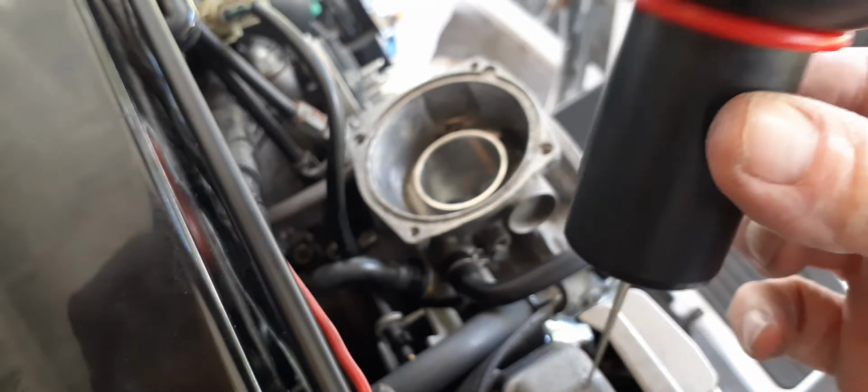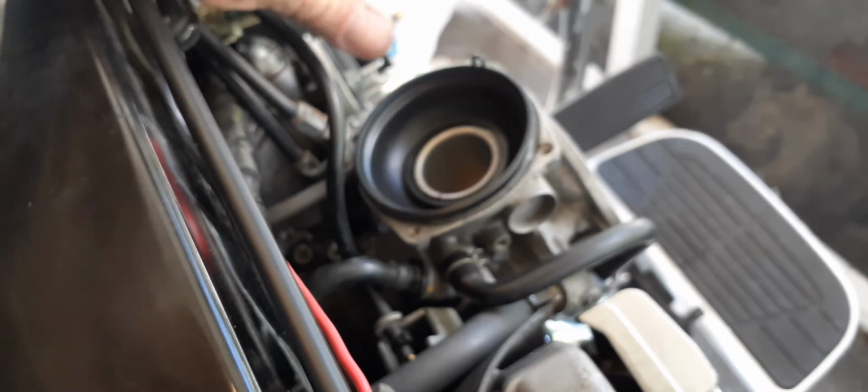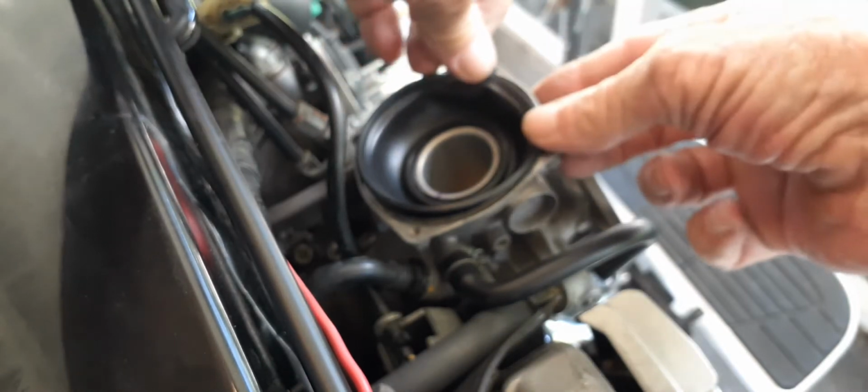I mean, they're really nice bikes when they come out, but I think the carburetors are just a little defective with that choke. But like I said, if they didn't use a choke on these or as lean as they are from the factory, you'd never get it cranked with a factory jet. But you put a 58 in there, which would come with a 55 pilot slow jet. You put a 58 in there, it'll start right up. You don't even have to give it any gas. This is the second one I've done with excellent results.